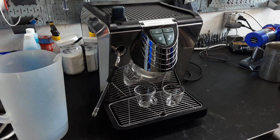A few things you might notice: the heat up time might take a little longer the more this thing builds up scale, and at some point your heating element is just going to give out. The issue with that is trying to descale a heating element like that. If you're not cautious and you're not taking it slow with a low amount of citric acid and spending a lot of hours descaling it, you might break your heating element, which means you would have to replace it completely.